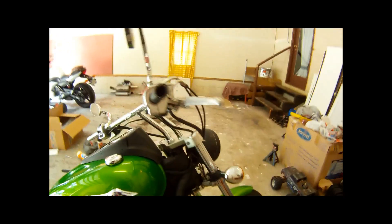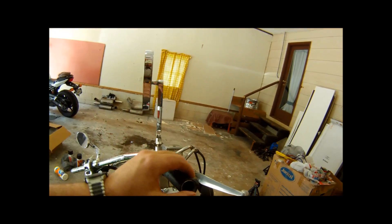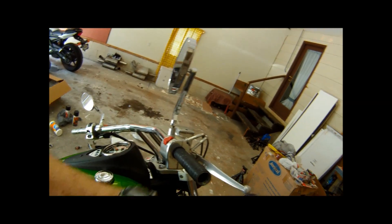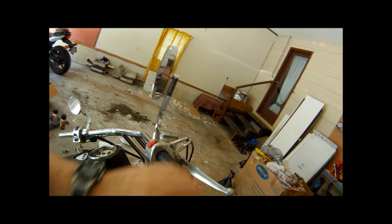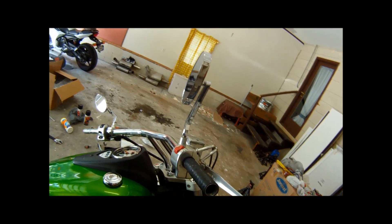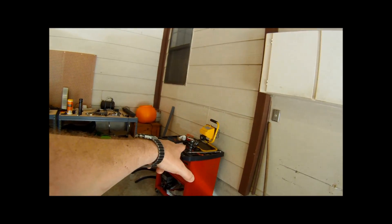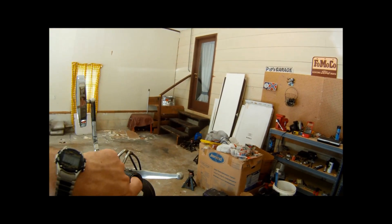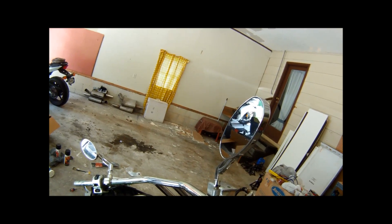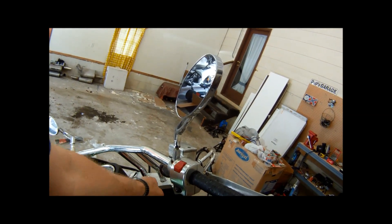The bar end's a little tapered from grinding the welds out, but it ain't too bad. I cut the plastic flash here flush, so I'll get the grips put back on and glued back on, then I'll stick the bar end mounts in for my turn signals. What I'm gonna have to do is glue the hand grip back on, put the bar end in, route my wires down and out. I don't think I want to pop a hole in each one, so I'll probably pop a hole in just one of these.